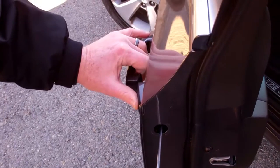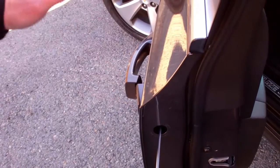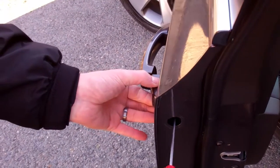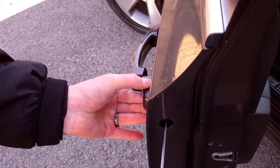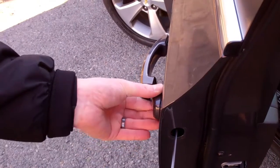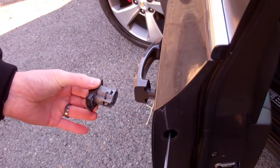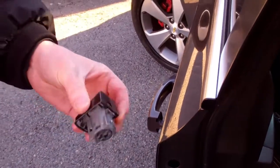From time to time, check, and when the handle will hold open on that retainer, you can go ahead and let go of the handle and continue to loosen while you now begin to pull out on the lock. It will begin to come out and eventually slide right out of the door. Once it does that, stop turning the Torx screw. Set the lock mechanism aside for later.